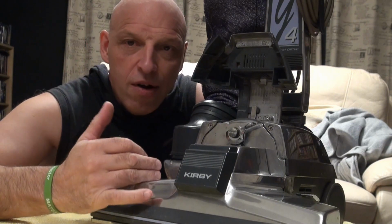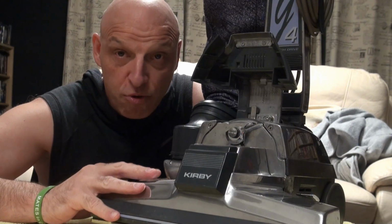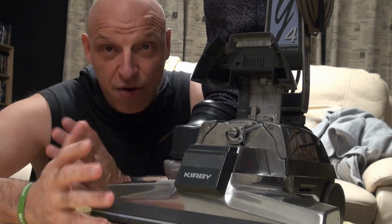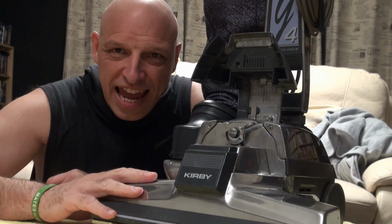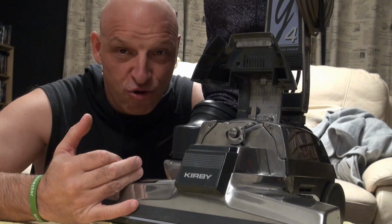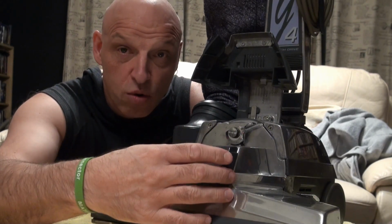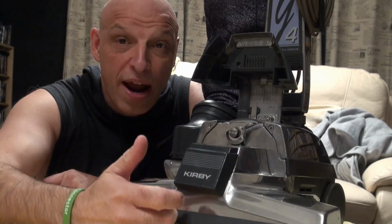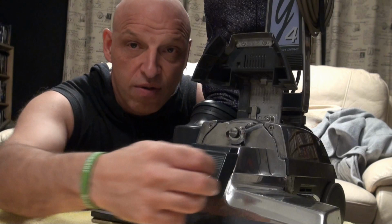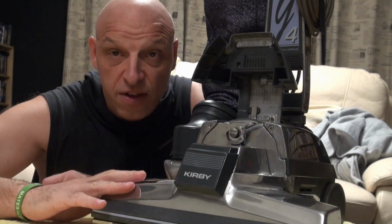So the idea is, if I can change this to a G6 head, I can then fit an oblique brush roll, in theory. So I've got a G6 head, I've bought an oblique brush roll, and I've bought a newer version of this. These are the older versions and they're quite stiff to turn. So I bought the later model G4, and I also put a link below to where I got that from. It has the handle that flips out and you can spin it round. So all I did was take the G6 one off, put the G4 one on, and then obviously I can fit the oblique brush roll.